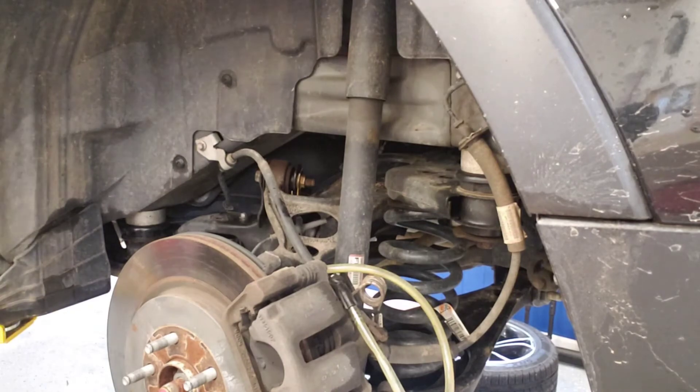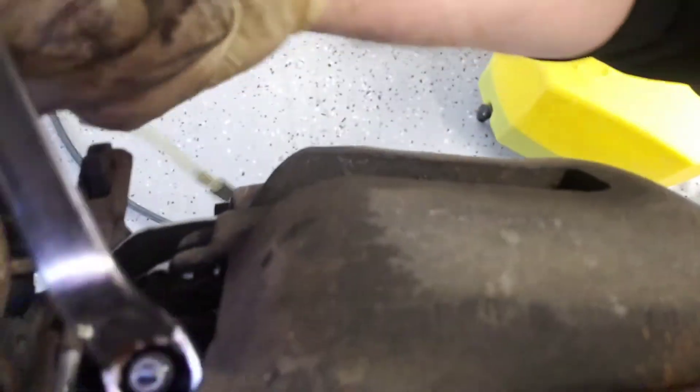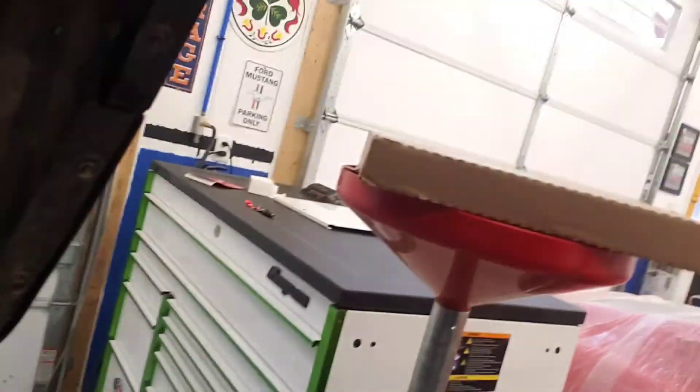When you're done at a wheel, here's the method: pull the hose off, then watch the bleeder — you'll see bubbles coming out of it. Give it a little tap to help get all the air out, because it can suck air back in if you're not careful. Once it's flowing and dripping steadily, tighten it down. Then wash it down with brake cleaner.